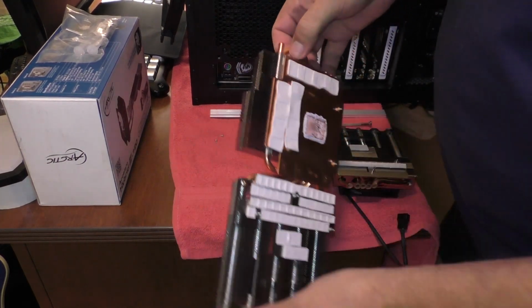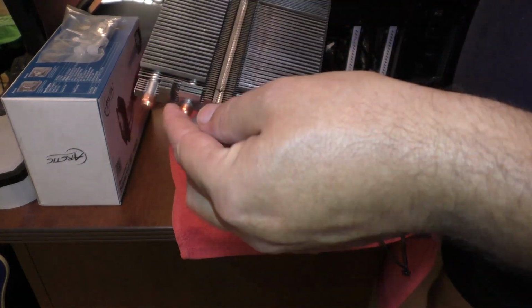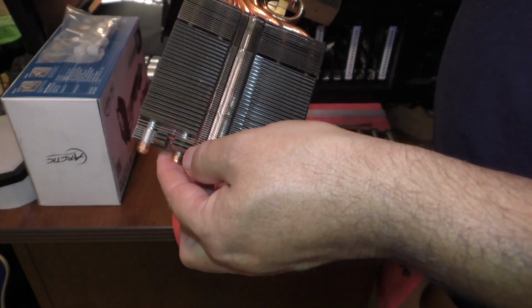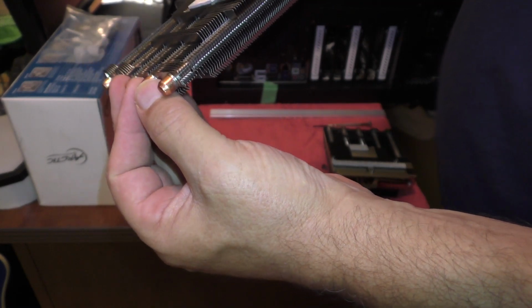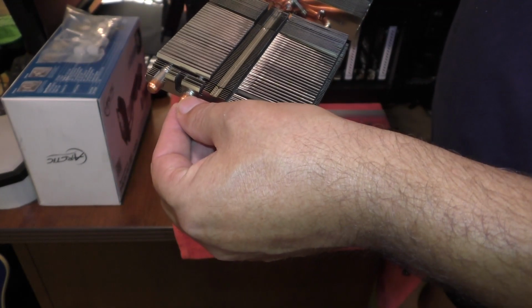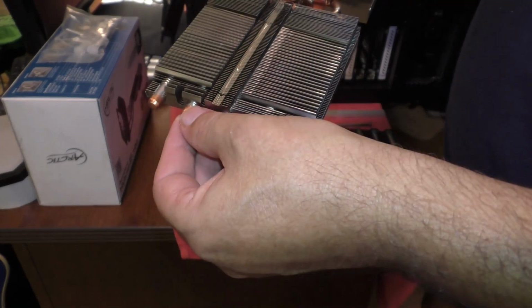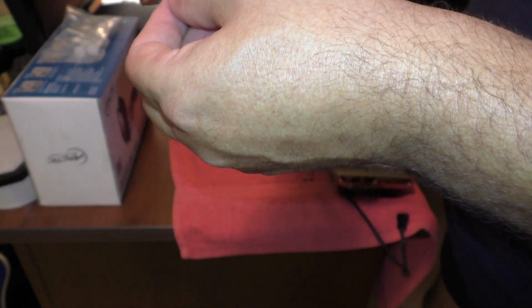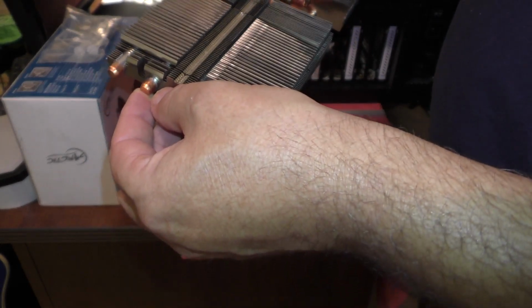Now here's the heatsink that came off of it. There's lots of copper on here. Again, I was mentioning the fact that the copper is actually sealed. I really don't understand the principle behind keeping that sealed. There should be air holes in it to allow the hot air that gets trapped inside the heat sinks, inside of the copper, to escape. I think it's just for aesthetics. Other than that, I'd say it defeats the purpose of actually trying to keep the card cool.